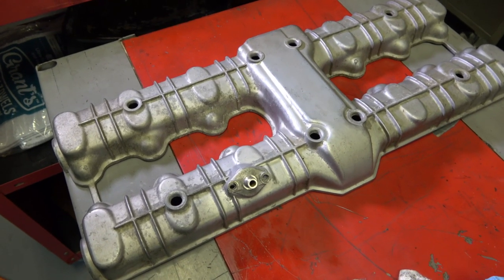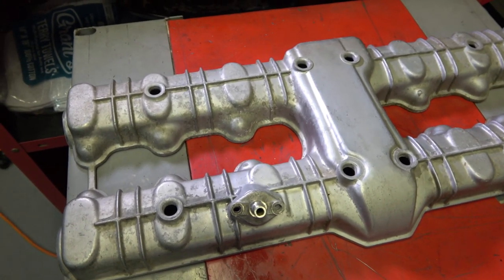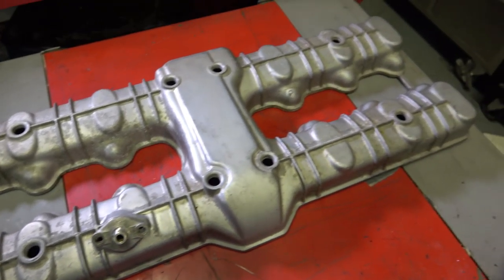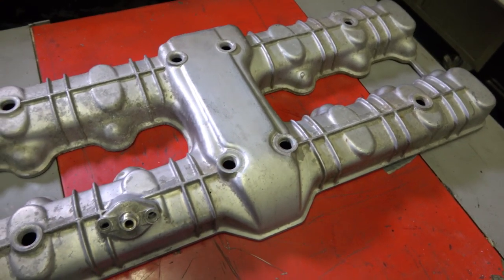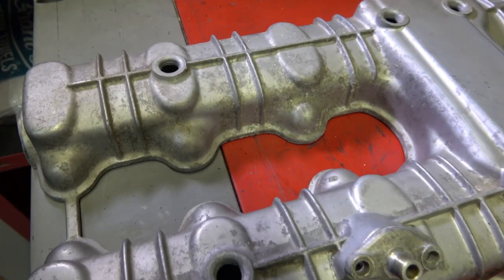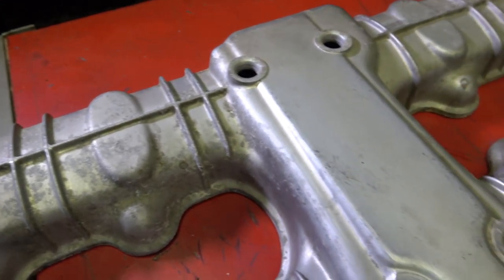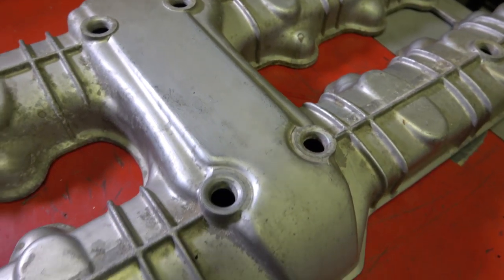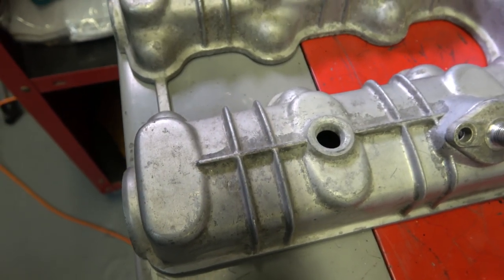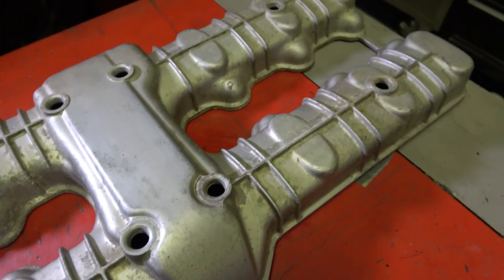So my next video is going to go over refinishing the valve cover. Now, on a 79 and 80 CBX, the valve covers were painted from the factory. They're painted the same color as the engine, so they look identical to the engine color. And as you can see, this valve cover is very corroded. Now, I've cleaned it up, but again, it's very corroded and really needs to be stripped down completely and then wire brushed and prepared for another paint job.